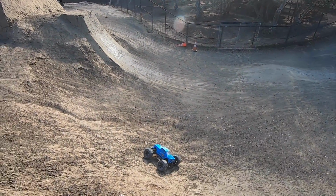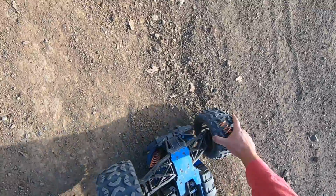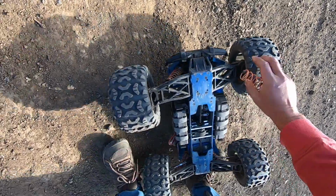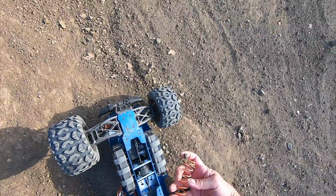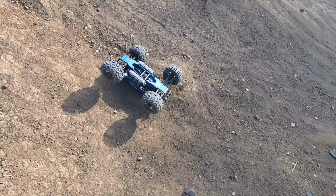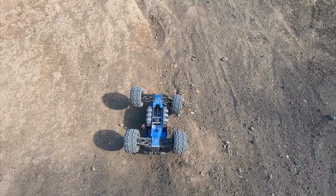Ooh, lost the spring. Okay, how'd that happen? Alrighty, looks like the front right shock. Okay, first damage. Broke a shock rod. Still got the rod end. You can see that shock rod broke, spring fell off, looks like it needs a new shock rod. So we'll have to buy some parts. That's just from a normal landing. So a little surprised at that, but it was pretty high.